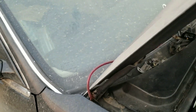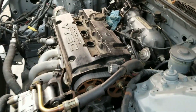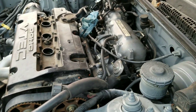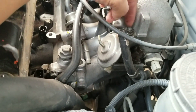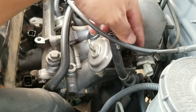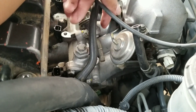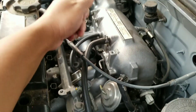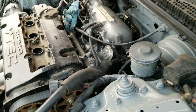Another thing I have to do is pin in the VTEC on the ECU side. On the ECU, we got a chipped P28 with an H22 basemap. We deleted the IAB — it's a sensor where at a certain pressure the valve opens, but instead we're gonna jump it and use a tee fitting for the fuel pressure regulator, so it'll be teed off and stay open once the car starts — constant flow instead of waiting for it to open.